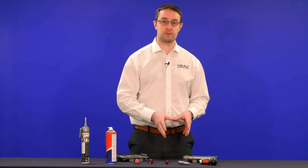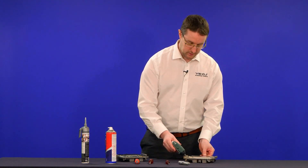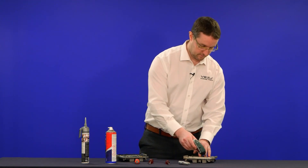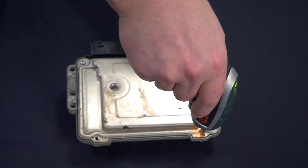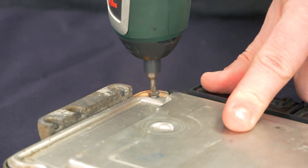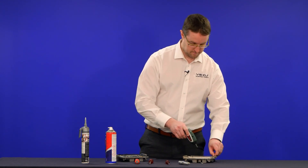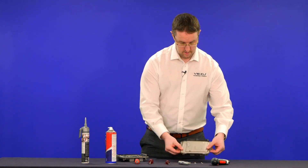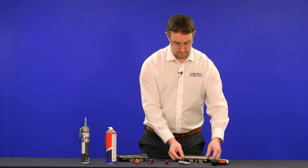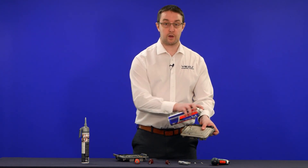Right, let's get into it. We're going to start opening the ECU, starting with our little electric screwdriver first and foremost. We'll connect into our torx screws and take them all out. So that's our four screws out and now we're left with the ECU lid still in place. The screws and securing pins are out, so now we need to soak the outside of that ECU lid around the edge with our brake and clutch cleaner.